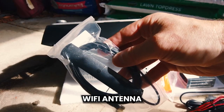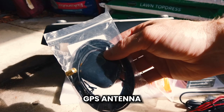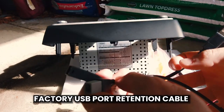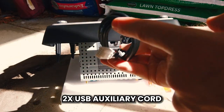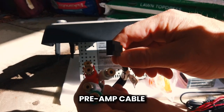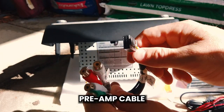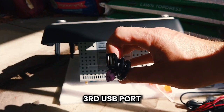There's a WiFi antenna — a rectangle one — you can just leave it floating behind the unit. For the GPS, mount it above the unit to give it a clear view of the sky. Factory USB port retention cables are included so you can retain your factory USB port. There are two USBs that plug into the auxiliary plug, an external microphone, pre-outs for aftermarket amps (you won't need this for this install), and a third USB port which is handy for a dash cam or 4G modem.